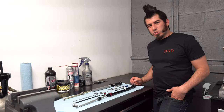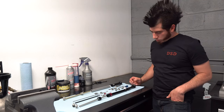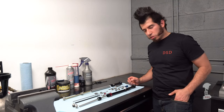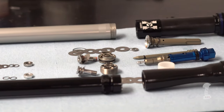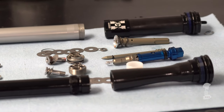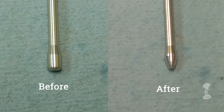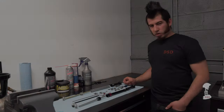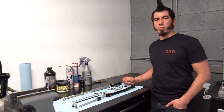Starting with the compression side on Charger 2 — it's pretty harsh out of the box. One of the main reasons is the shape of the low-speed compression needle. The stock needle compared to Charger 1 has been described by some customers as looking more like a ball joint than a needle. We actually take that and reshape it here in-house to get more fluid flow past that needle. Reshaping the needle allows more fluid to bypass the shim stack, making the fork way more supple.